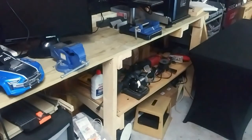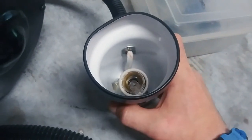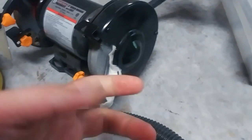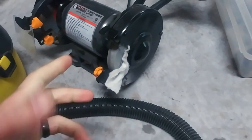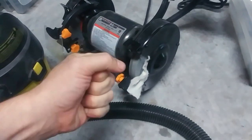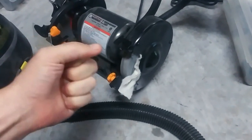This was fun. Notice how that space is there and how that's like on the ground and how there's broken glass everywhere. Look inside of this thing — it's busted. What happened was I was grinding that and it started to get hot, so I used this to hold the metal while I was grinding. My dad's always taught me that every time you work on a grinder, you have to have a firm but loose grip, meaning that if something snatches your hand, you want it to just pop right out of your hand. You don't want your hand to go with it.